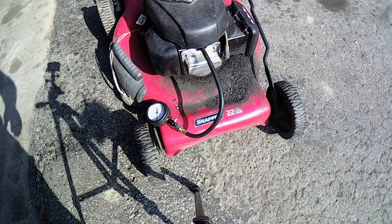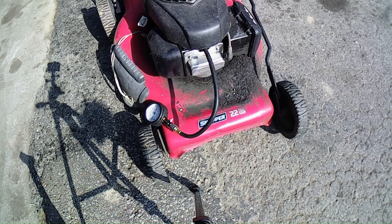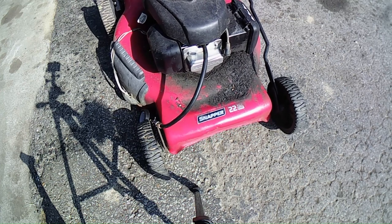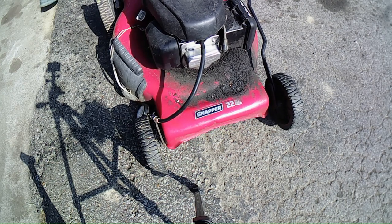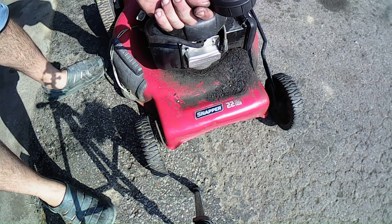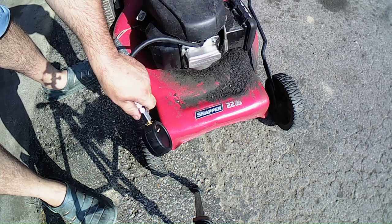We'll check it out. I'll pull it a few times and we'll see if we get any compression out of it. So, here we go. And probably got a compression release too, so we're probably fighting that as well. And we're barely making 50. I'll try it again, but that doesn't sound good.